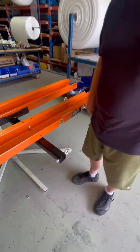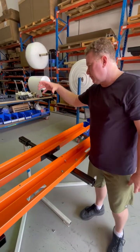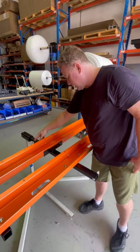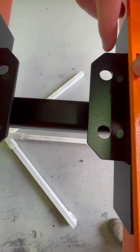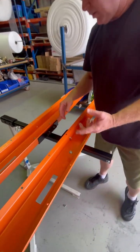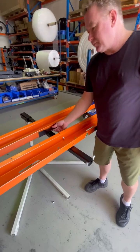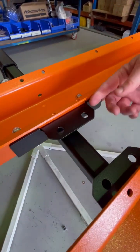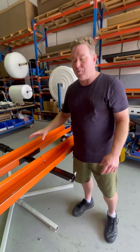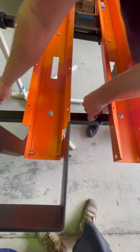Just going through this quickly. On the inside bike, you can strap off the frame or the seat post each side. So on the inside bike, you're going to strap down onto here and onto here — that gives you a bit of spread; there are two points you can hook to. On the outside bike, you're going to tie off here and here. Then you pull the bike down mainly on the frame in the centre. You only need to pull it down 10mm and the bike will be rock solid. Then you can put a secondary set of straps up front just off the bars or the forks.